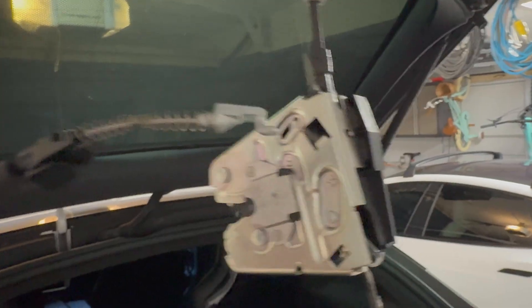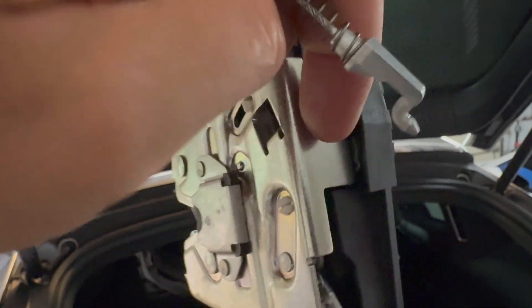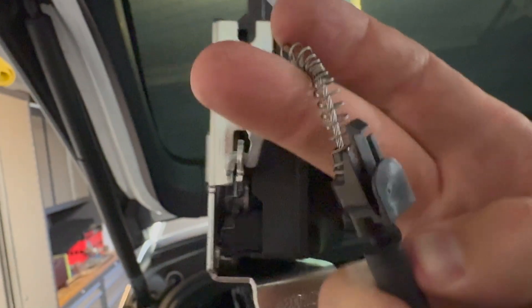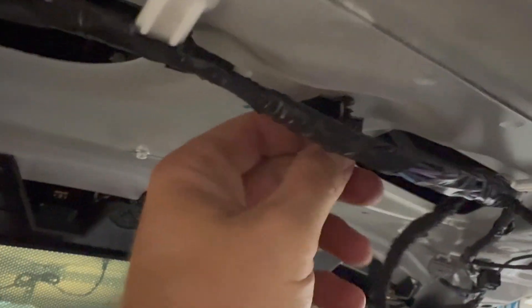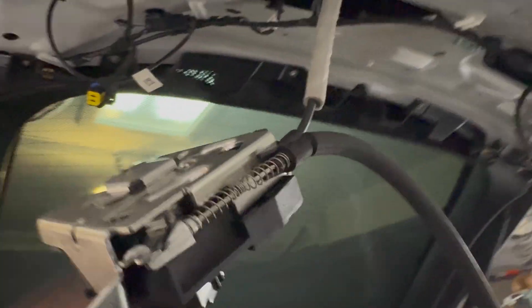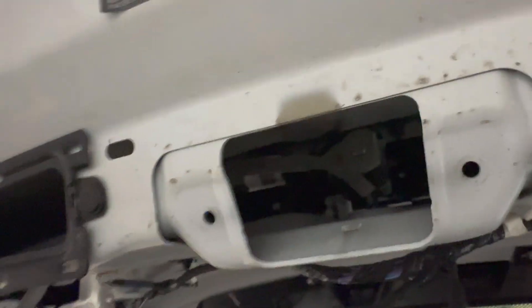Let's get this thing installed. Here is the latch — the other end of that cable has a hook and a spring, which hooks into this little eyelet and then clips into this end here for the secondary clip. We hook the hook into the eyelet first, then pull this clip over so the little hook on the end slides into the hole. The emergency release cable is still routed through the tailgate down to here, and now we have everything all attached and ready to bolt in.